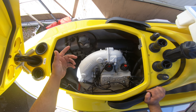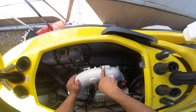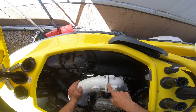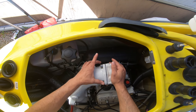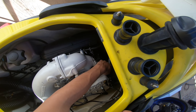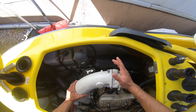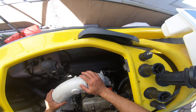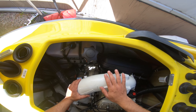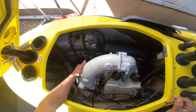Okay everybody, so I had installed this pipe but unfortunately when I plugged in the water it started to leak from up here, so I had to order a new gasket for the exhaust. I obviously had to unbolt it again, but I didn't want to disconnect it down there — I disconnected at the top, found the bolts, disconnected that clamp, and managed to wiggle it out. I got the new part next day, did some testing, and it runs good — it does not leak water this time. I think it's ready to go to the lake, so I'm going to hook it up and take it out.